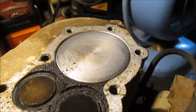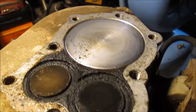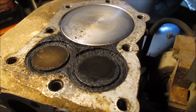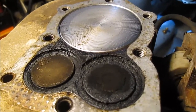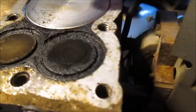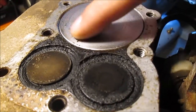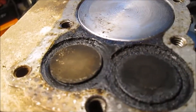There was a little oil on top of the piston. Here's the head. You can see there's some carbon in the motor. I've been running premium fuel with a little Marvel Mystery Oil and, of course, I always have my Seafoam in the gas — a little bit of detergent. It could have eaten a little bit of stuff off of this piston and the exhaust.